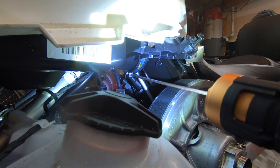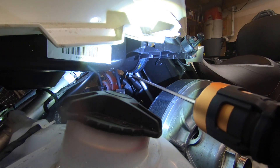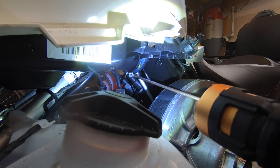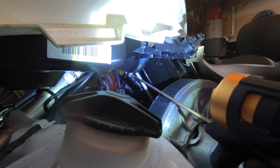While we're in the clutch area, we'll loosen the clamp holding the intake to the air box. This is required because the air box is part of the upper bodywork. Don't remove the screw completely — just loosen it generously.